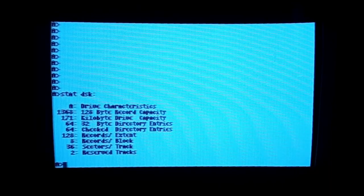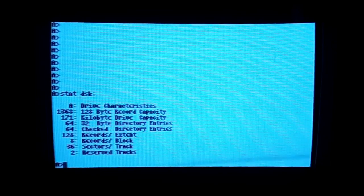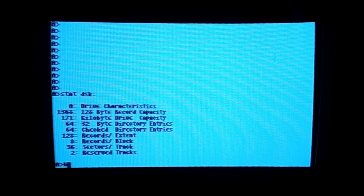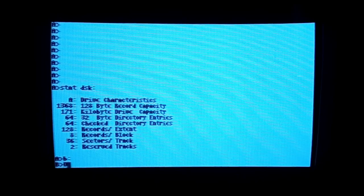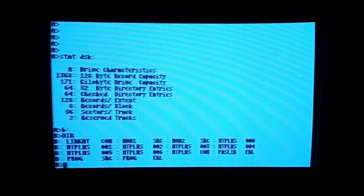A very nice feature of Indus CPM is that it's running on a real Z80 using real file systems on actual disks as well as images. What that means is that you can delve into the operating system itself and come up with meaningful information. Here I start with simple commands such as stat to get information about the drives and devices, and dump to display the contents of a submit file on the screen in hex. These would work equally well on Fujinet's Run CPM, of course.